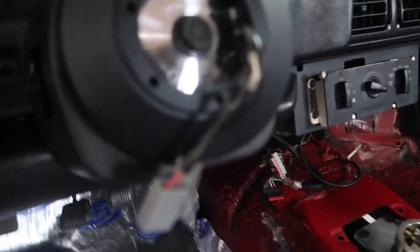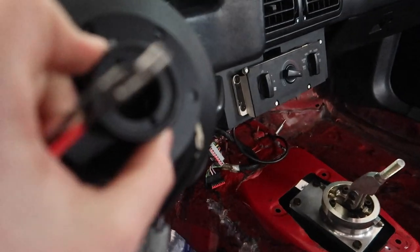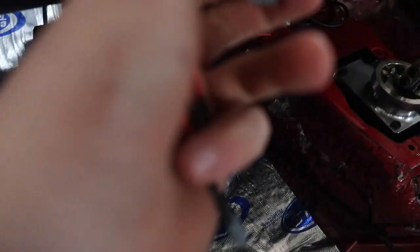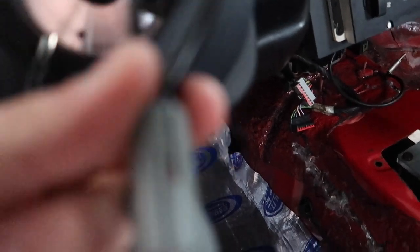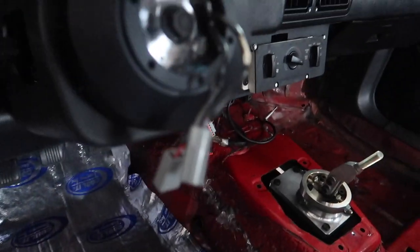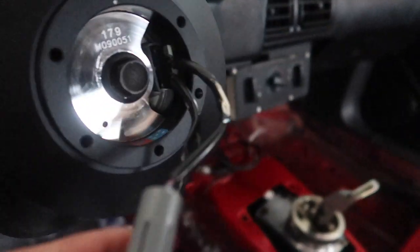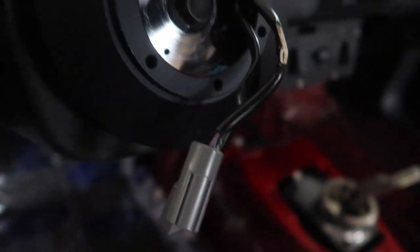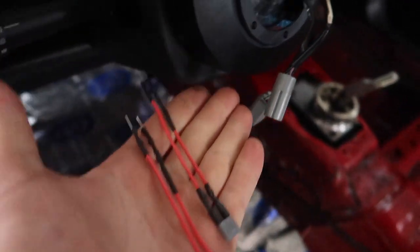After a quick examination of how thick these wires are on the fox body, I can't tuck them under the quick release, so what I'm gonna have to do is splice these wires with the fuses on the end and then splice them into these connectors. Once I get that all done, I'll go ahead and come back and show the finished product once these are all spliced.